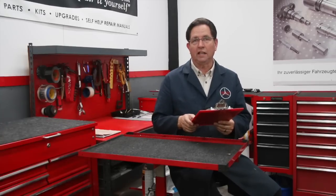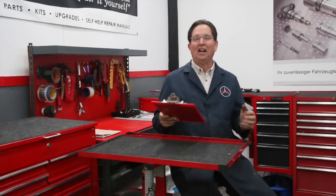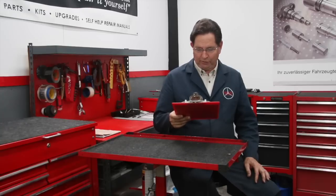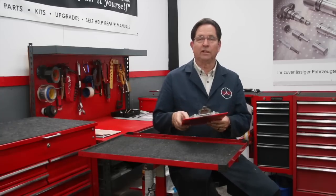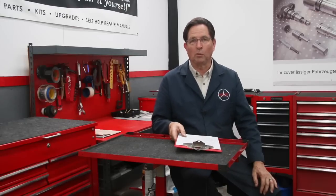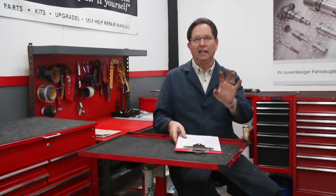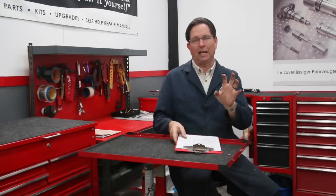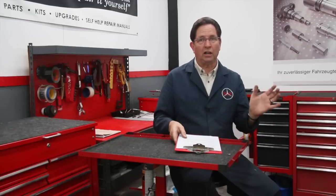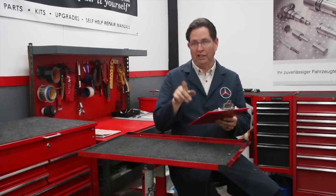Here's the next question: I have a W123 1981 240D with a manual transmission, 315,000 miles — I would like to change the rear end to a lower RPM while driving down the freeway. Since your car has a manual transmission, I would recommend you try to find a 1985 model W123 rear end. They lower the ratio down to 2.88 and that makes a wonderful car. It's not real difficult to install but it is time consuming, and if you have a lot of rust in your car it can be really tough getting to a lot of bolts. I'm sorry I don't have any videos on rear end replacement, but you can Google that too and find additional information to help you replace the rear differential.